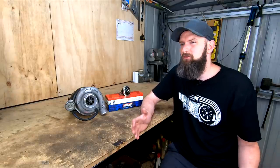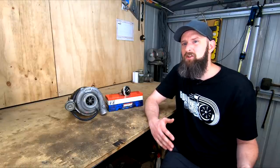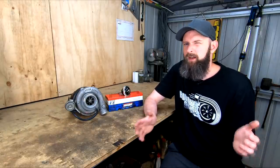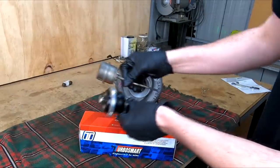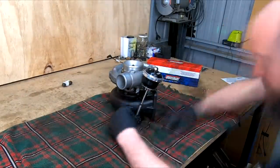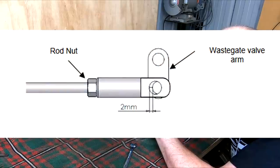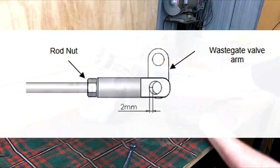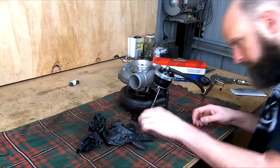Not ideal for spool speed and other controls, but good for our little rods. The factory wastegates are pretty reliable, but they're really getting up there in age, deal with a lot of heat, and I'd imagine the springs or seals will fatigue at some stage. It's a common upgrade when modifying or tuning these cars up, so it's not really wasted if we go after more power later. And unlike the factory ones, these aftermarket units can be opened up to replace the spring, upgrading from the factory spring setting of around 4.5-5 psi to the more common 7 or 12 psi — or right up to 'are you sure you want that much boost' levels. TurboSmart instructions list the preload as being 2mm, meaning the rod needs to be adjusted to 2mm short of fitting over the wastegate pin. I've then used some compressed air with pressure turned right down to 10 psi through an old bike tyre valve to open the actuator and slip the rod end on.